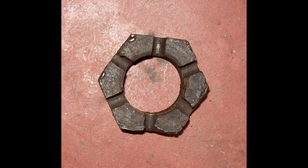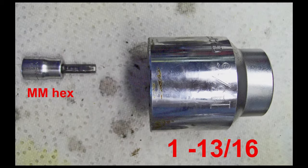You'll have to have a really strong impact to remove this rear axle nut. It's 1 and 13 sixteenths — I don't know the metric size. You can use a breaker bar and a pipe to get the leverage you need to break this loose, but I had a real strong impact. You'll need a 6mm Allen wrench to remove the front spindle nut. This is the 1 and 13 sixteenths socket with 3/4 inch drive to remove the axle nut.